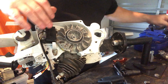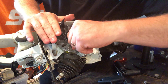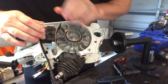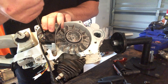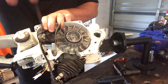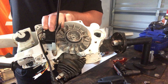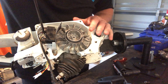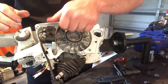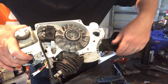So that's sitting down there. Now you need your business card — slot that in between where it is, and then the flywheel comes around onto the magneto there. It magnetizes onto there and holds it all in nice and tight. Make sure you push that in, hold it in, and screw that down. That business card gives you the correct spacing for the spark to travel across from the flywheel up into the ignition module and run the engine. Be very careful with these screws, they're just little and they'll break. Once that's seated you can pull the card out and you've got your correct distance running across for your magneto.